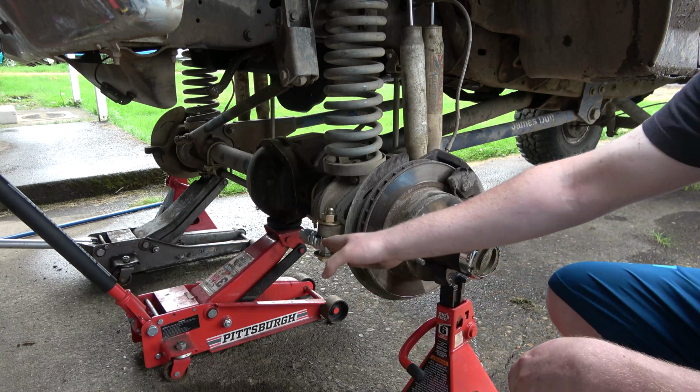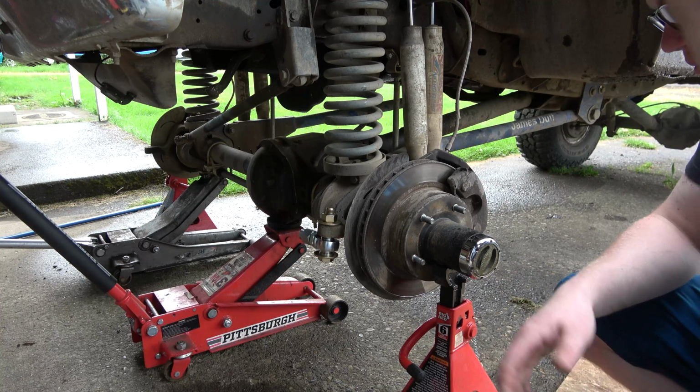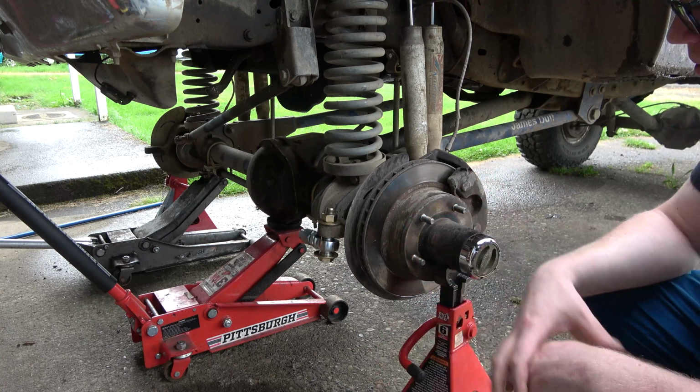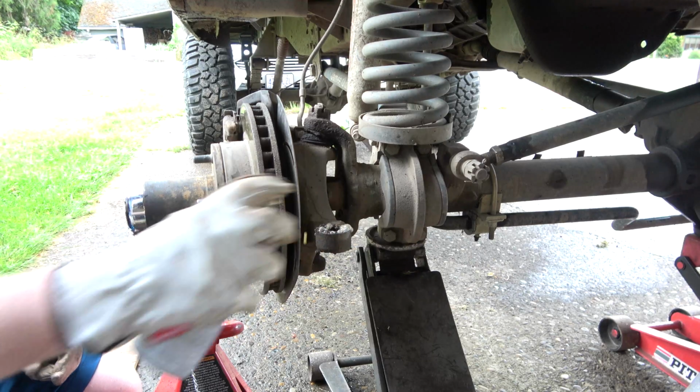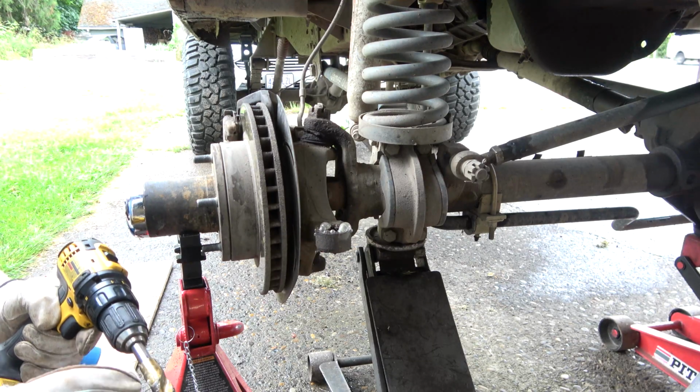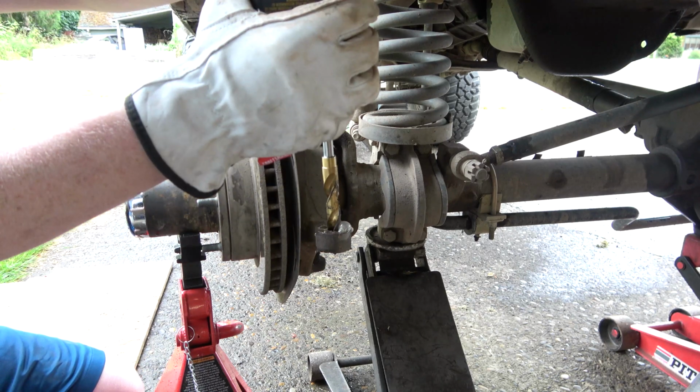Basically, in total length, we got to have 55.5 inches, and then we'll leave ourselves with adjustments so we can get the toe just right. Just coat her in some kind of oil here, and the key is to hold onto the battery end.